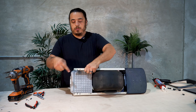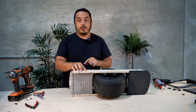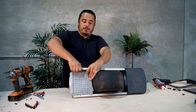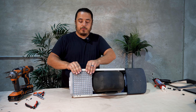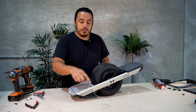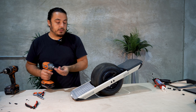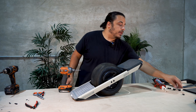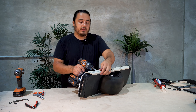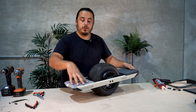We're going to take this enclosure and push it into the far channel — the one that doesn't have the wiring harness on it. Try to put it all the way into the channel as much as we can, and then without pinching your fingers, pull the rail that we freed over the enclosure. Now would be a good time to reinsert these four screws — those are the only screws that we left uninstalled into a component, so they should be easy to find. We don't want to over-torque this — I have this on the second-to-lowest torque setting right now.